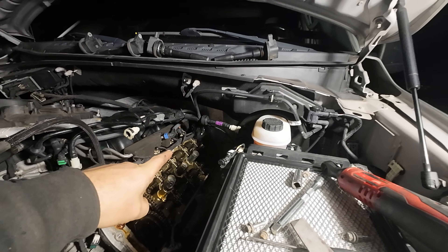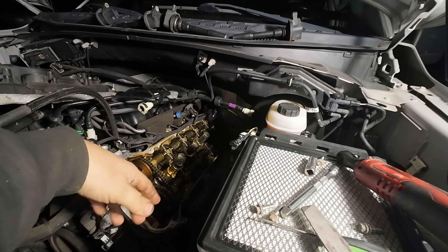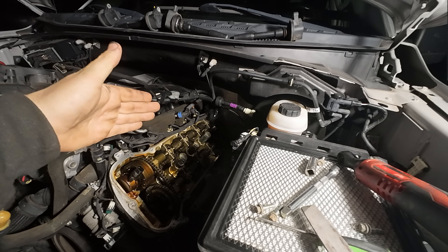No — you have to replace all four because now you've got these old rockers everywhere else in the engine. Are you just going to put new rockers on old cams on those other three? Either way, you've got 32 valves and four camshafts. Now you're up to about $2,800 just in parts. Throw eight to ten hours of labor on that — you're looking at a five to six thousand dollar repair, rough math off the top of my head. This repair here takes two hours and $33 in parts. So at $120 an hour, you're $240 in labor, plus $33 in parts and an oil change — you're looking at about $300 out the door.